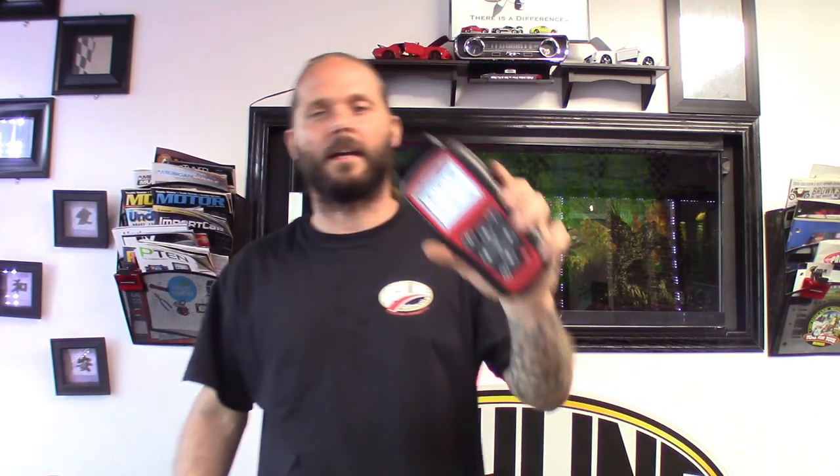So like I said guys, the TS508 is a great TPMS tool — it definitely beats the snot out of the Snap-On one. We paid big bucks for the Snap-On and I'll probably still use it, but it just got trumped by an Autel product that does it all. The Snap-On needs a scanner to finish up certain jobs; some it can handle, but others require the Verus to finish the relearn procedure. I also noticed this one IDs sensors quicker than the Snap-On does. Hats off to Autel — they make great products and great scan tools. In the TPMS game they've pretty much got it locked down, especially for an independent shop.